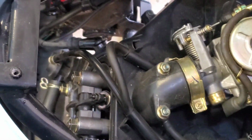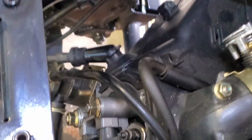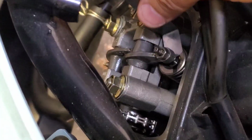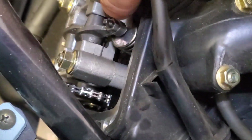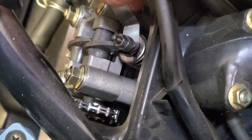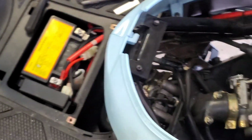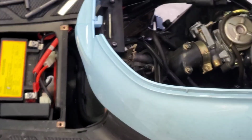All right, there. So I just got done adjusting your valves to 0.004 and 0.005 on the valve lash. So these should be pretty well set now. Yep, perfect amount of drag on the 0.004 for the intake, and I just got done setting the exhaust. Now I'm gonna have a look at the valve seats.